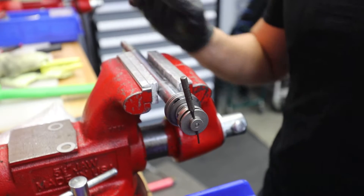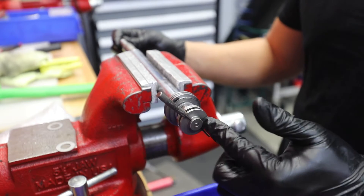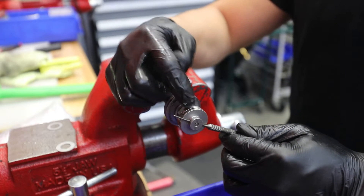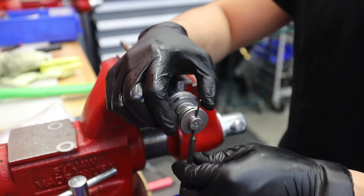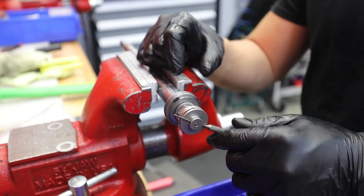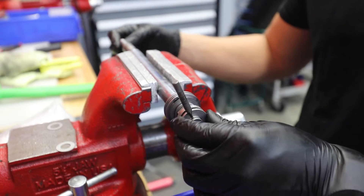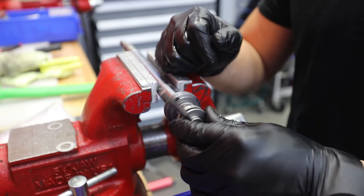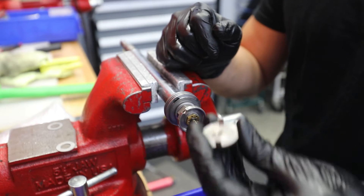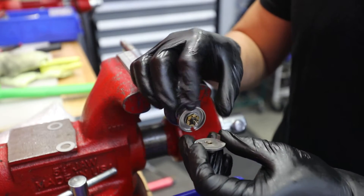To explain a little bit about how a rebound works — when you turn this knob over here, I'm turning the rebound knob right here. Usually there would be a pin right here, and as you rotate it, this nut will move up and down. And that will reveal these bleed-off holes that allow you to adjust your rebound. And that's all controlled by this little rod that's connected to the rebound controller. Pull this out and you can tell how it rotates just by fitting in those grooves.